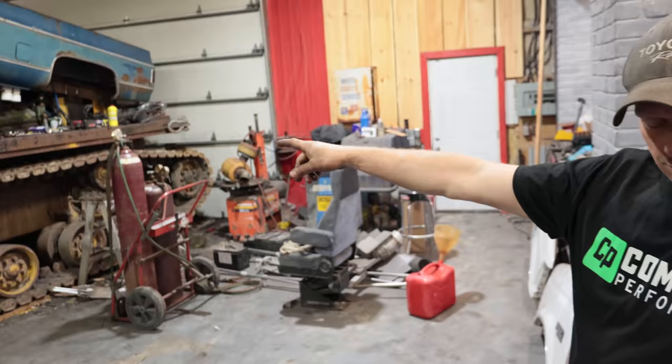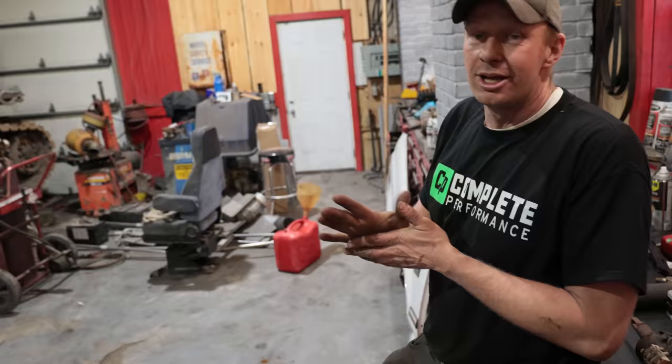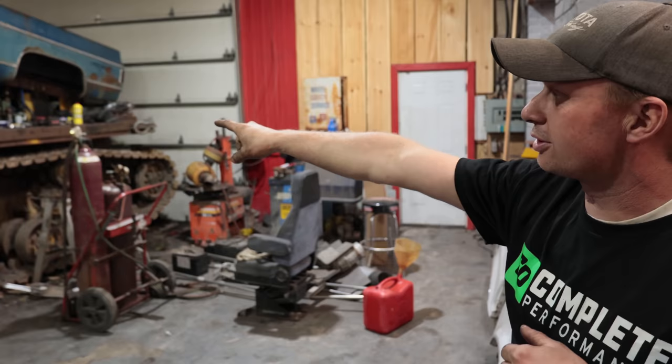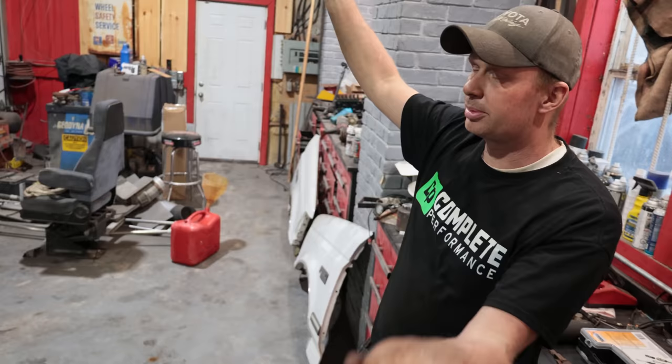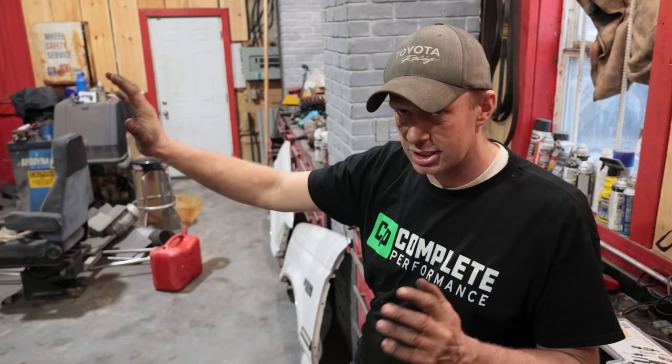Don't touch those. What that also allows me to do is put a toggle switch, like an interrupter, right where the handles are to tilt the truck up. So I can fire the truck up, get out of the truck, lift the truck up, put my safeties underneath, and then shut the truck off from the controls beside the truck. If there's an issue, we blow a hose or something stupid or the winch or something happens, we can always shut it off down below. So that's a much nicer setup for doing that.